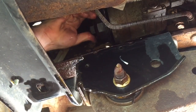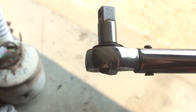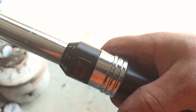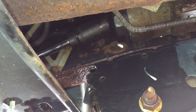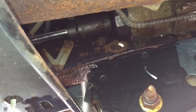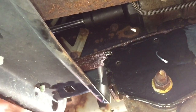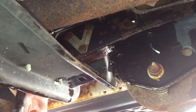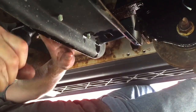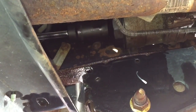I've got it pretty tight by hand, about as tight as I can get it right now. So I'm going to go ahead and use my torque wrench and it's going to be set to 19 foot-pounds of torque. Back under there, and once I get my torque wrench down in there, I can go ahead and tighten it. I used 19 foot-pounds of torque, which is the specification for this particular cap on this particular vehicle. Once I hear the click, I'll know that I'm at the torque setting.